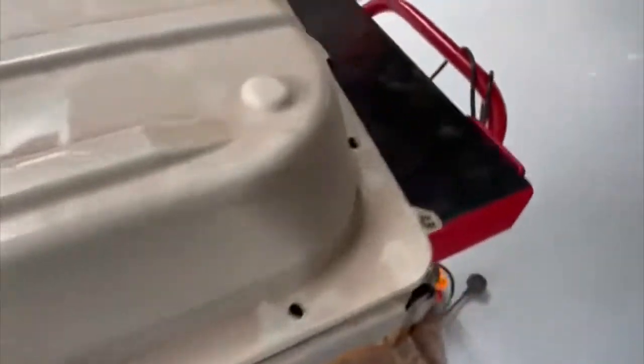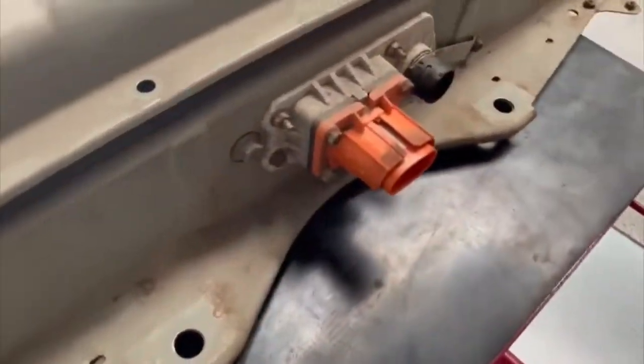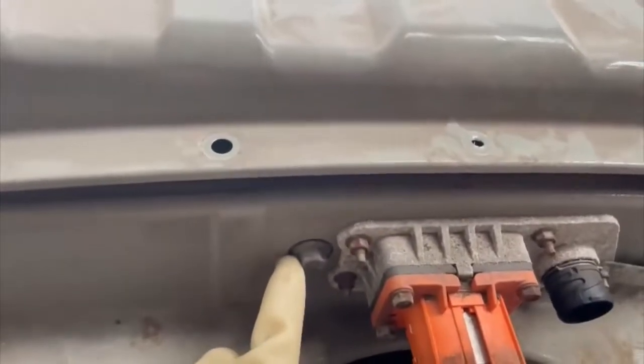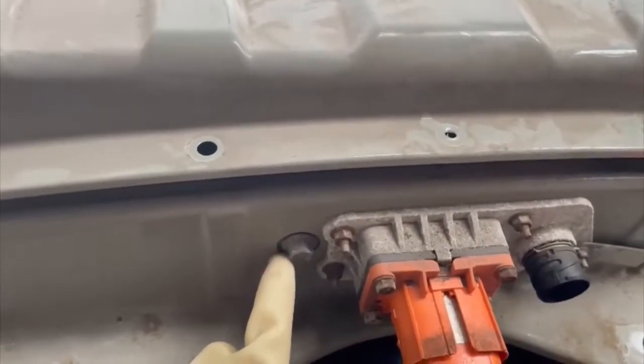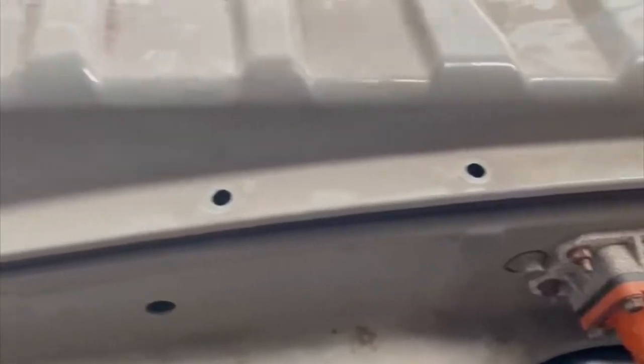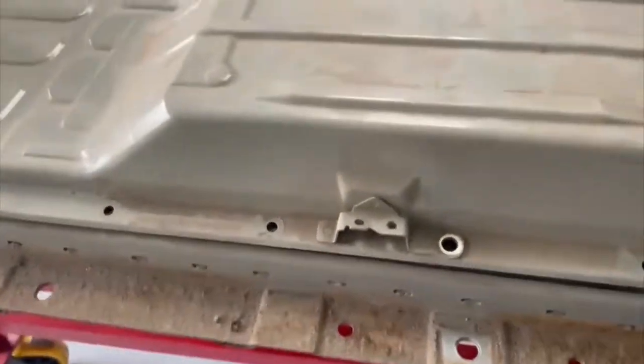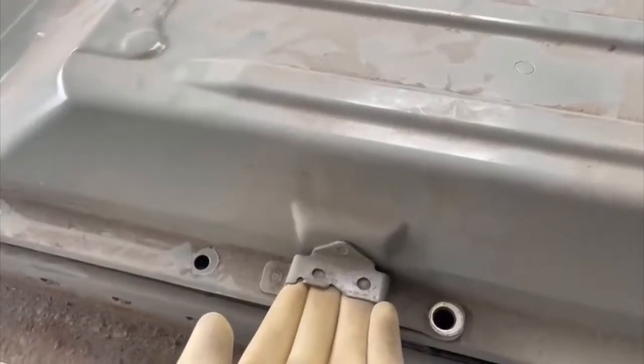The cover is now quite loose. You'll see there is a sealed rubber gasket on these — when sealed, they're hermetically sealed and have a gas test that pressurizes the battery to check it doesn't leak, using that port on it. I'm going to get a colleague to help lift off the cover, using the lift points on either side.